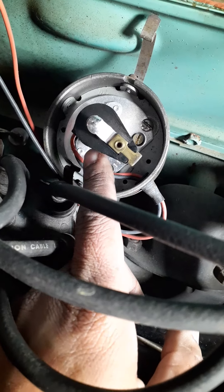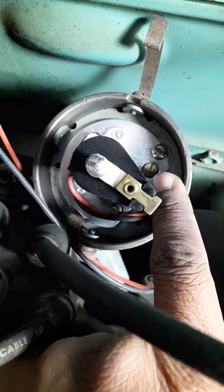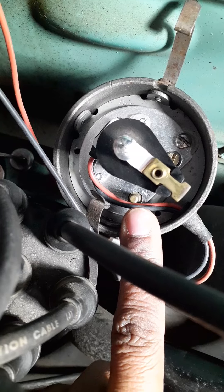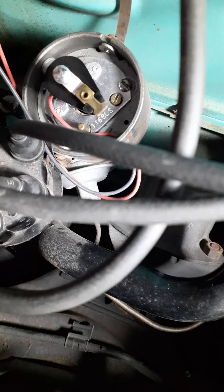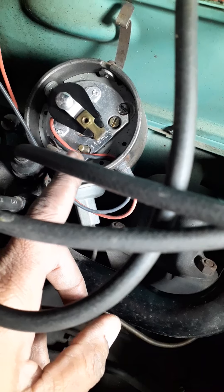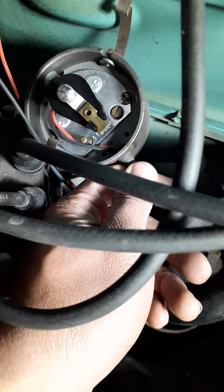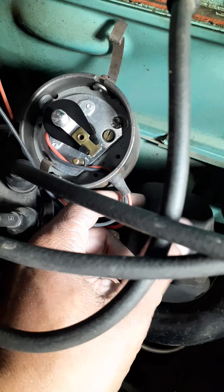This CD plate — you use this bolt here to bolt it down, and there's a hole here that it lines up to, and then it lines up on here. So that's how I knew it fit perfect right in that spot. You do have to take this off first — this part just pulls right out. Once you remove this, you place this in, line it up to that bolt, line it up to that stud, place it in, put your wires in — this here just gets pushed through, it's a grommet. Once you do that, it's in there and it's ready to go.